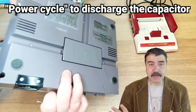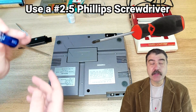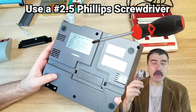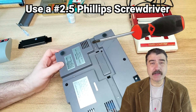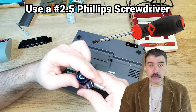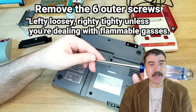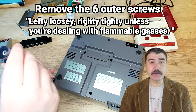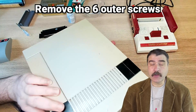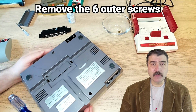First of all, unplug everything. Hit the power button on and off to discharge the capacitor — you might see a red light blink for a moment. In order to do this, you need a standard size 2.5 Phillips screwdriver. The screws in the NES are recessed quite a bit, and you need a long enough regular screwdriver. The smaller ones are going to be next to impossible to get in the right place, and there is a chance you can strip the screws. There are six screws on the bottom of the console, and you want to turn left to remove them — lefty-loosey-righty-tighty. It's also okay to use a magnetic screwdriver because the NES has no internal hard drive. Turn the console right side up and the screws should just drop out — place them in a little bowl so you don't lose them.